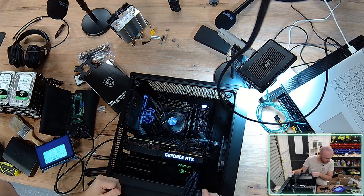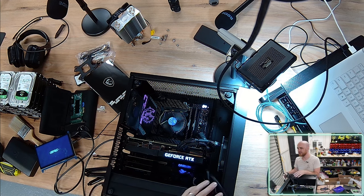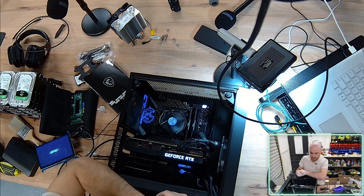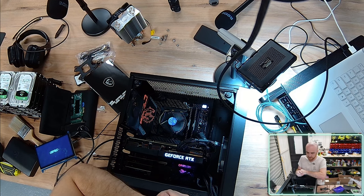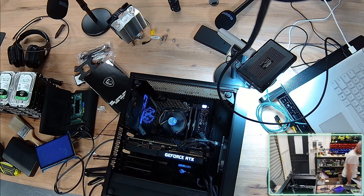Memory modules were found on non-optimized memory slot. That is pretty fancy. Okay, in that instance, I think it was trying to tell us to move to slots 2 and 4 rather than 1 and 3. That's probably the default optimized ones. I just couldn't remember before. So I'll switch that out shortly. Just letting it do some boot up diagnostics.